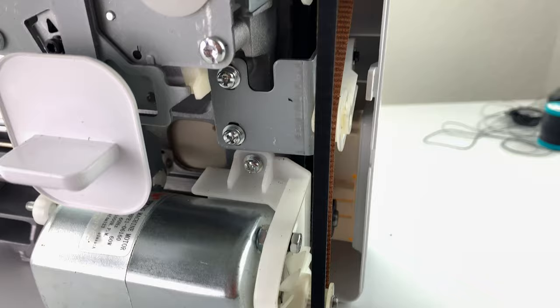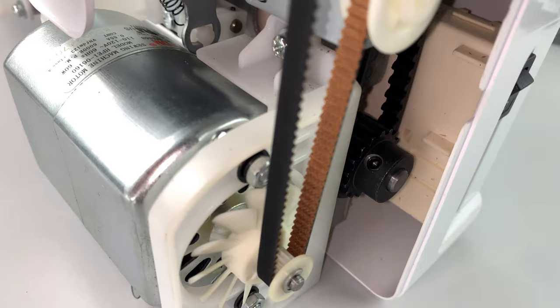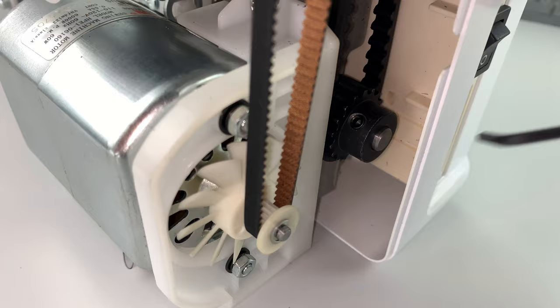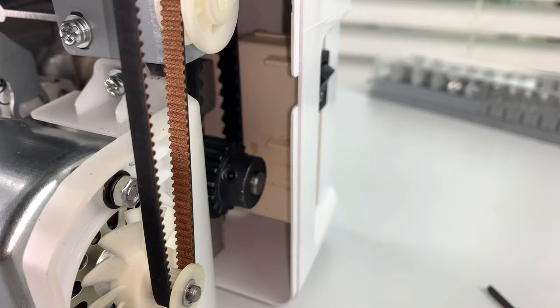The main part we're going to be fixing and focused on today is the little driver on the back right there. That driver has two Allen screws that we're going to be loosening up in order to free the lower section of the sewing machine — which is the bobbin case. With my two-millimeter Allen key I'm loosening up the screws. You don't have to remove them completely, just loosen them to free your bobbin case.